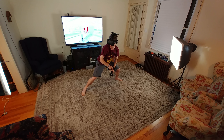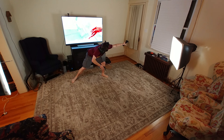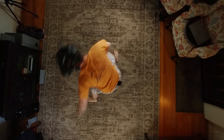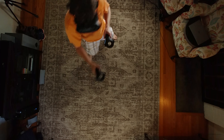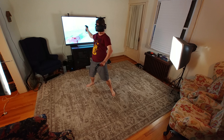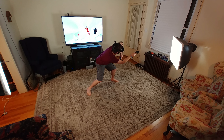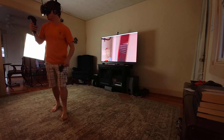This utility will let you know the signal strength in real time, making it easy to tweak the positioning of the sensor in relation to the VR space if need be. The wireless adapter itself sits on top of the headset, providing a generally good position for wireless signal transference, and is installed slightly differently depending on whether you've got a Vive Pro, or a standard Vive with either that deluxe audio strap or the original cloth Velcro strap. A tiny version of the 3-in-1 cable connects the three ports on the Vive HMD with the same three ports on the wireless adapter. Either of these cables will replace that long cable connection and the breakout box itself, so there are now two additional ports free on your PC.